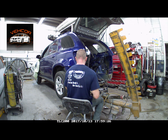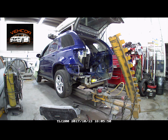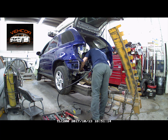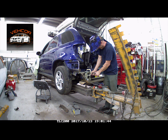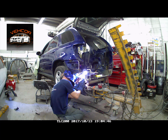We're getting that floor a little bit straighter. Now we're spreading out the rail, flattening it out, getting all the kinks out of it. Now we're going to weld the floor back down to the rail — it pulled a couple of the spot welds out when it got hit.